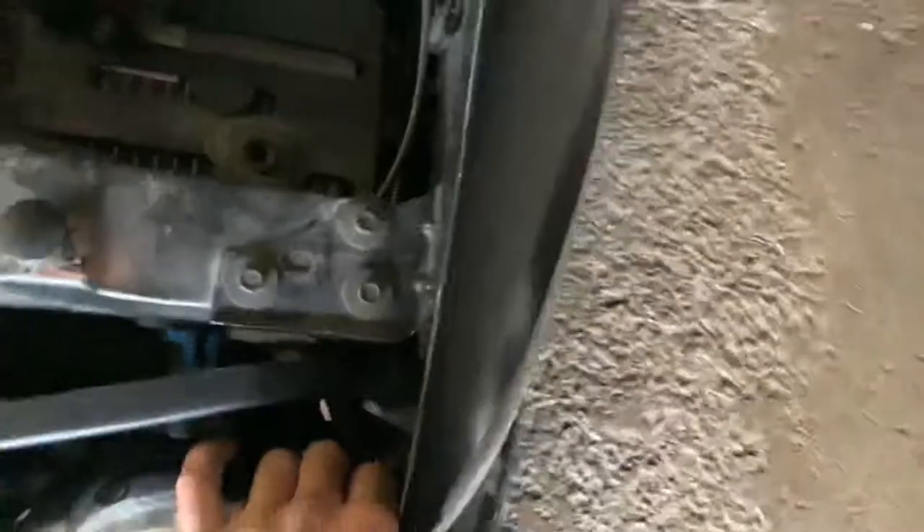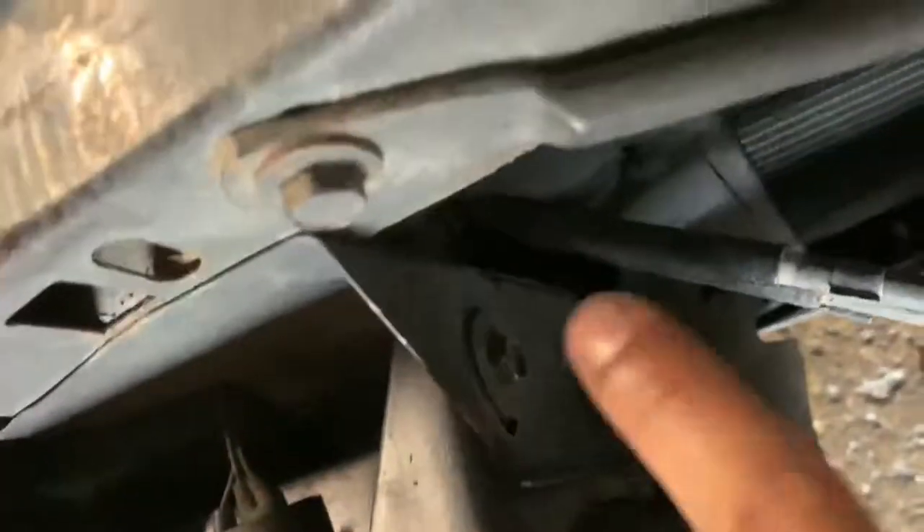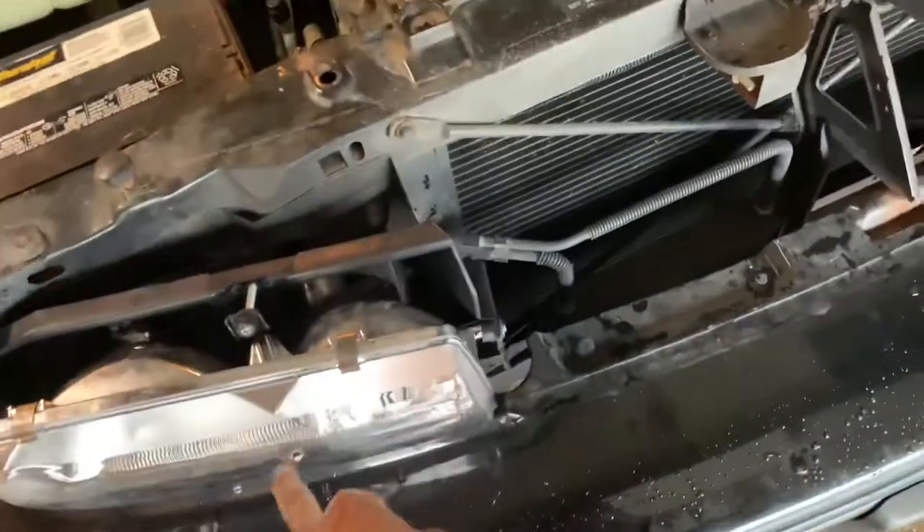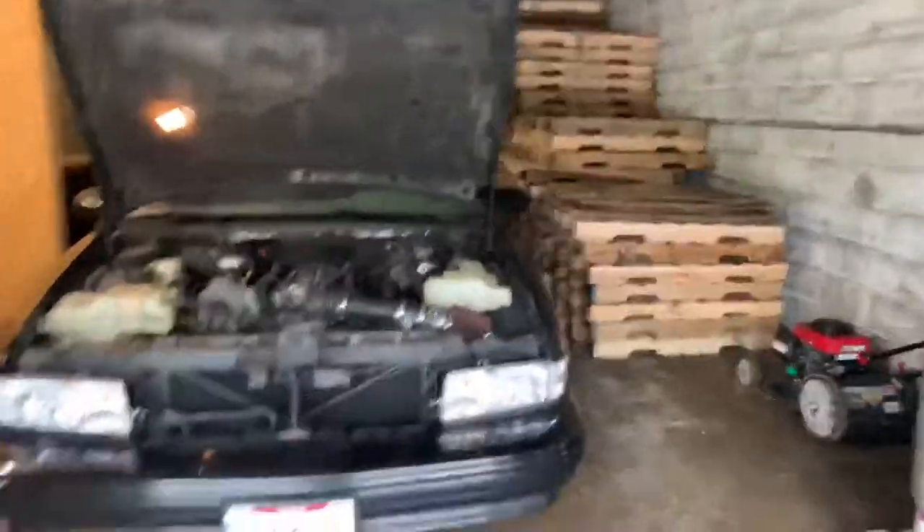So basically, when you get in here, you're going to have these two screws right here, which I believe were a 10. And then you're going to have another one of those 10s in here, and you're going to have this screw, and another screw — that's all 10. So it's basically like four screws. Out with the old, in with the new. That's if you get the two-piece assembly — the headlight and the corner lamp. Now if you get the one-piece assembly, you've got to take out this whole bracket right here. The one-piece slides in, but that's pretty much it. Pretty simple — easy modification, I did it myself.